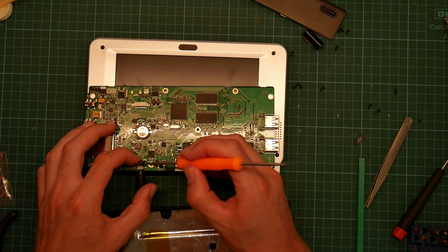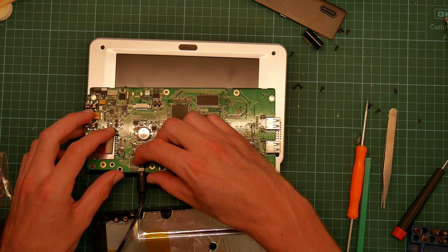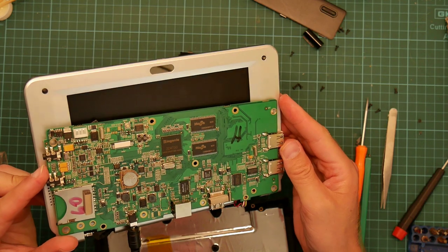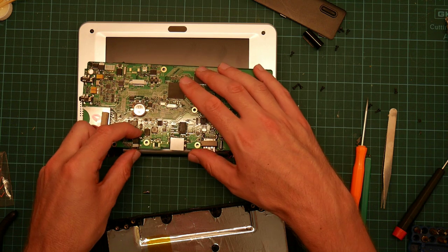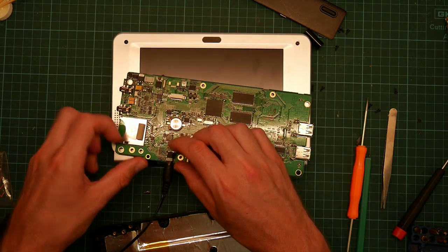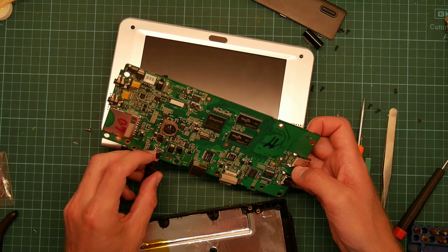So the epoxy here is now completely hard. But it did flow down onto the PCB, which is why it didn't really hold the top on. And the whole thing is slightly skewed, so yeah, I think I could do a lot worse than simply attempt the same repair again, soldering that pad on and adding more glue. I can add glue around the back as well, that will strengthen the whole thing.